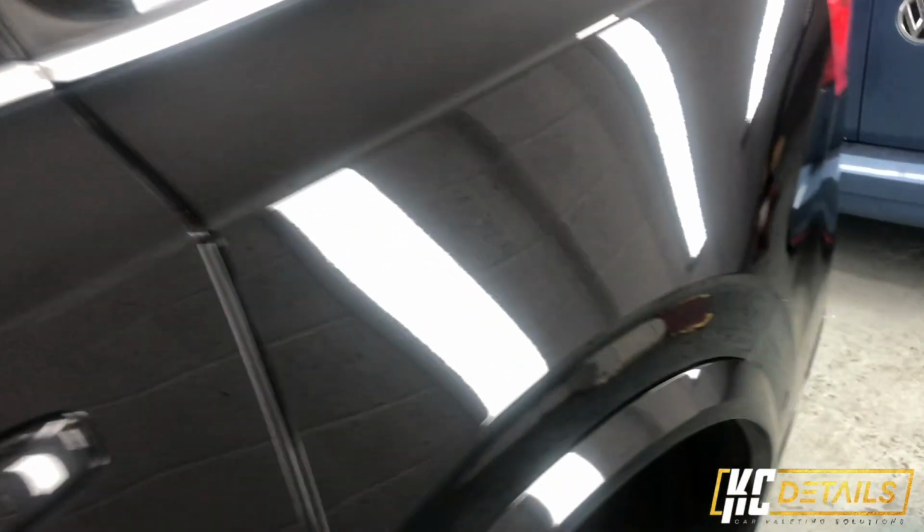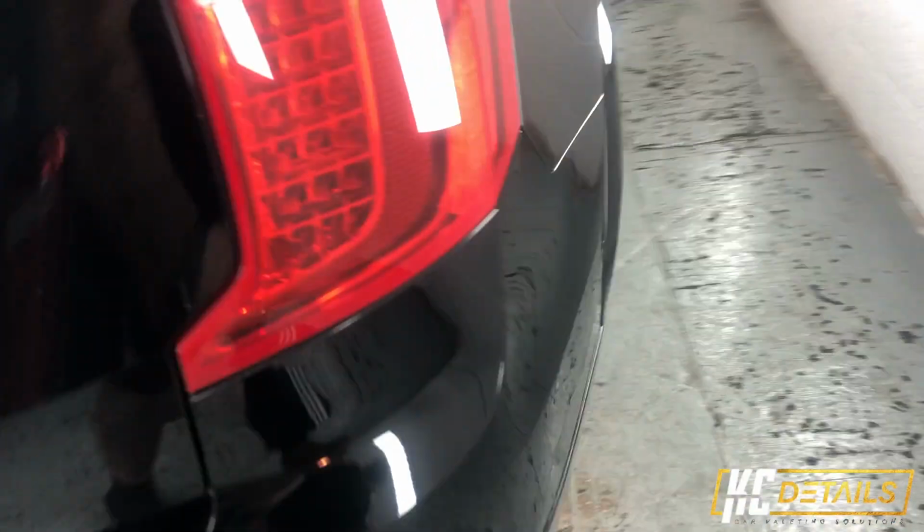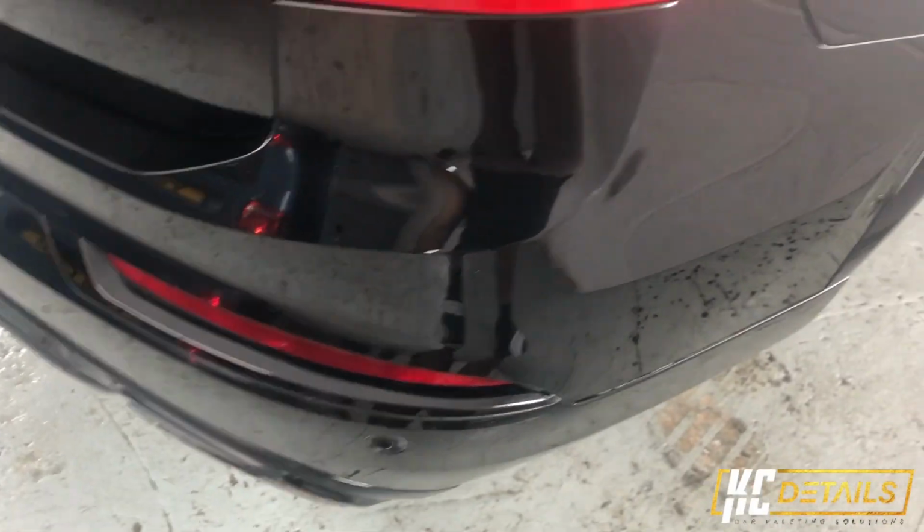It's pretty bad. Oh yeah, and the paint's pretty bad as well, but we're just looking at deep scratches right now. We've got the swirls, we've got the medium scratches, we've got nasty things like that. That all needs to get wet sanded out. Scrapes, your tailgate area stuff, taking stuff out, putting stuff back in. It happens. Badges, obviously. At some point, this has been resprayed. Got some lacquer peel there we need to be careful of. This one's a bit nasty.